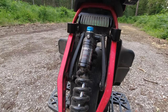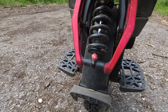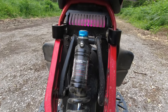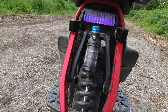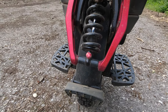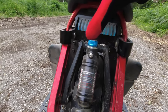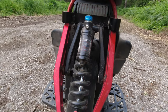The suspension has been working really well when you upgrade the sliders. I have added little washers and stuff into the suspension at the bottom arm. I've got pretty much running my suspension on medium settings, so everything is in the middle. So the rebound is about 13 clicks from fast, and I think the hard and the soft, the compression side is set to also like 15 clicks, I think.